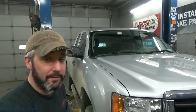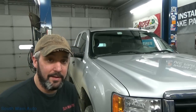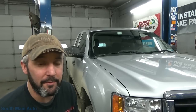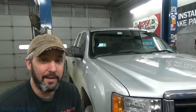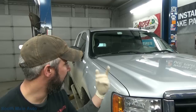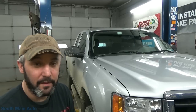Welcome back to the South Main Auto Channel. We've got a 2011 GMC Sierra half ton with the 4.8 liter in it. A guy stopped in the other day - the check engine light's on and he has to go on a trip. It had an EVAP code, your classic P0449 for the EVAP vent control solenoid. I ordered a solenoid, figured I'd bring you guys along. Pretty common - we'll see what we got.